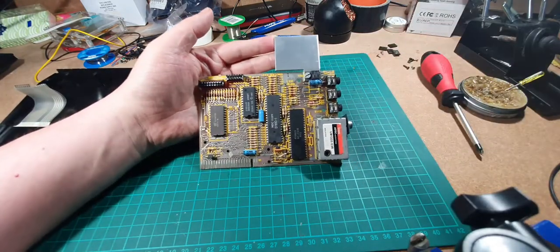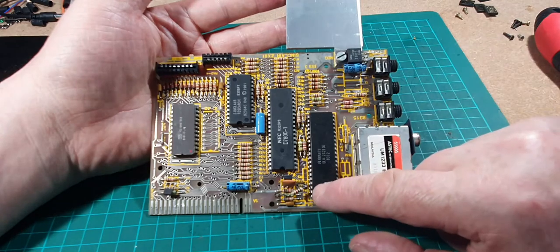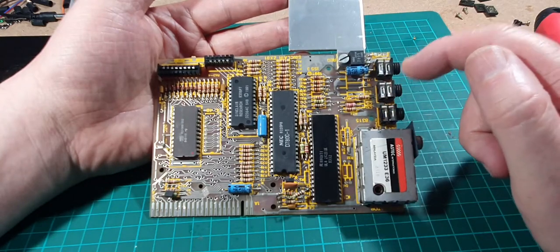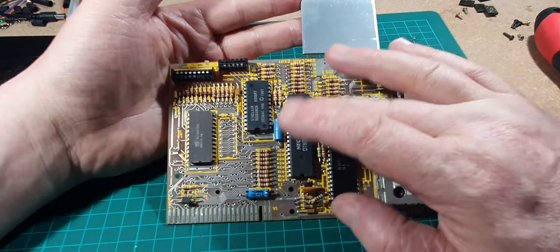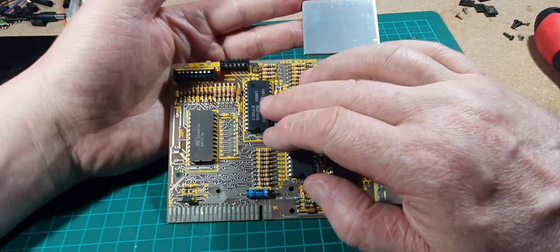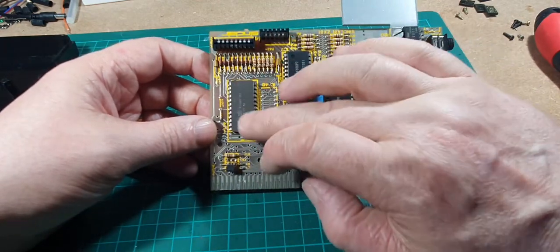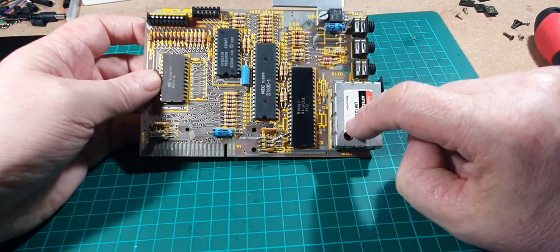This is the basic circuit board. I'm not going to go into great detail of how it works, but just so you know: we've got what's called the ULA down here — this looks after all the instructions the computer has to do, and acts between the input of the tape deck and the video output. We've got the main chip here, which is a Z80. We've got the ROM there with 'Sinclair Research' on it and a date code of 1981. And this is the 1k of memory here — you can have two chips or one chip, which is what we're going to be replacing later.